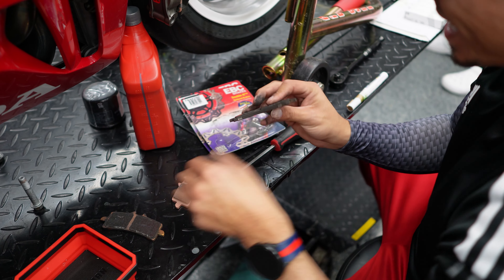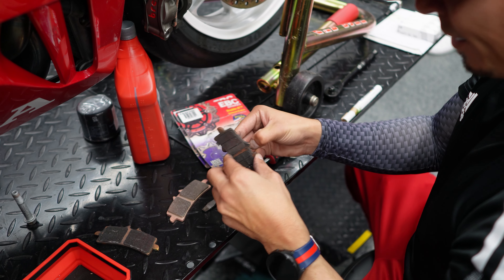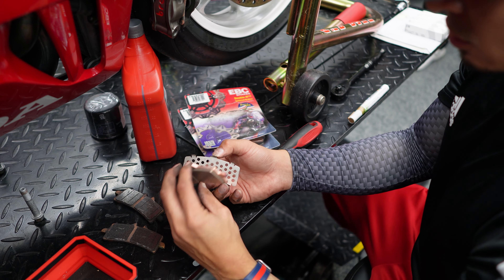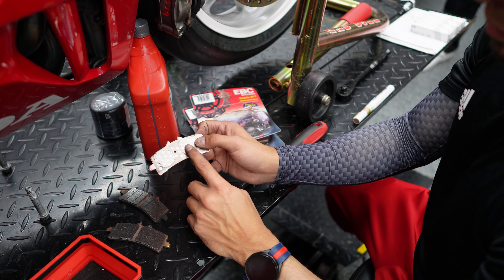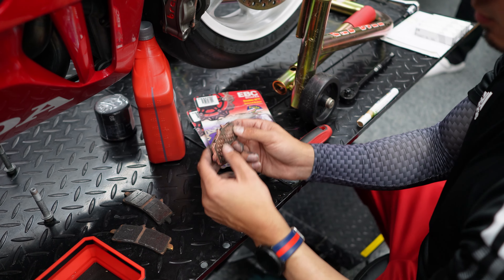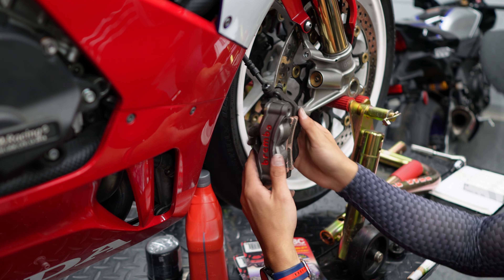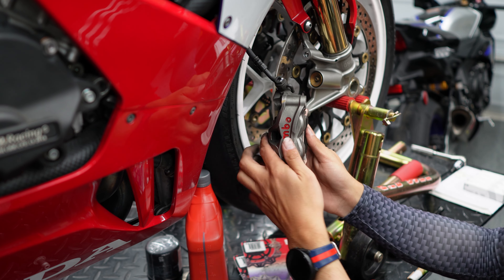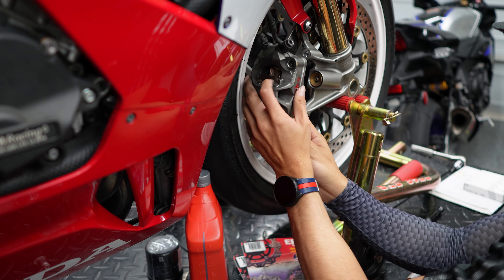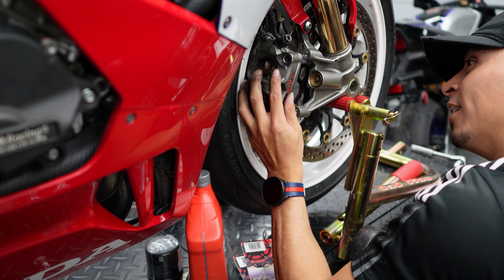Honestly the wheel is in the air so I barely touch the front brake. The OEM pads had a piece included — I'll keep going with it. This is where the two brake cylinders press on the pad. I open the caliper up enough to have space to slide the rotor back in. Before I forget: once you put this back on, go ahead and pump the brake — you're going to have a lot of space and feel like you have no brakes.